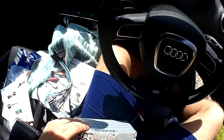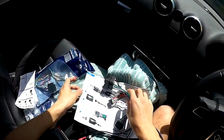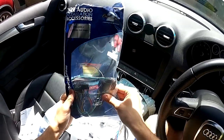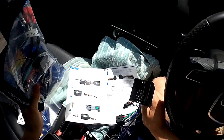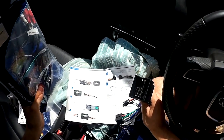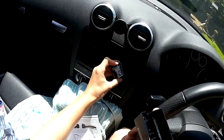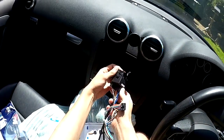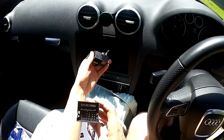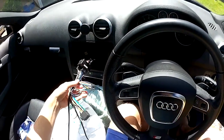The next thing is to connect the main power. You'll get two wire connectors in the kit — one is for the 12-pin quad lock connector, and you may need to use the other for an ISO adapter. This will end up plugging in — I think that's the correct orientation at the bottom. Pull it down and now that's into place, so you're converting the leads.